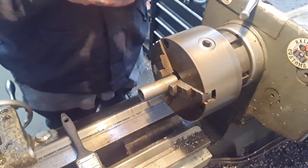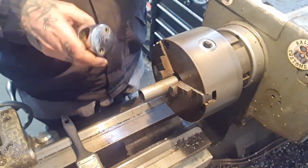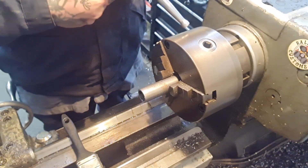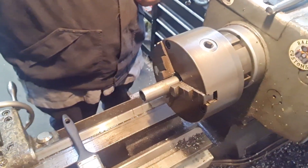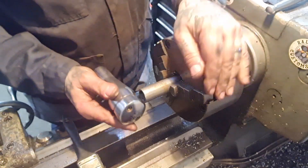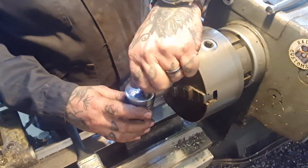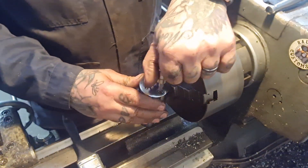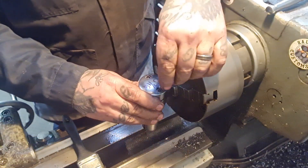So we've come up with a way of machining these risers. What I'm going to do is the helicopter method. I just need to loosen that off. We need to take that three-sixteenths off one face. What I'm going to do is clamp them onto a bit of inch tubing as tight as I fucking can — which is quite tight to be fair. Let's just see how that fucking lines up with the jaws — the inside, the other end of this, is hard against that jaw.